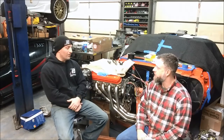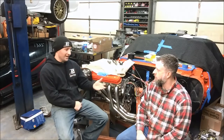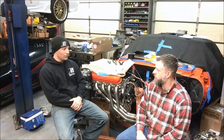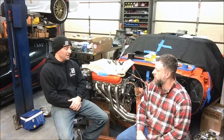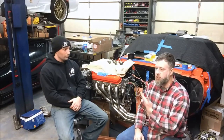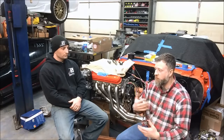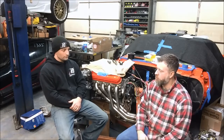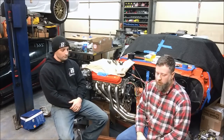On our harnesses, we offer that customization to our customers. If somebody says they're running an LS2 intake manifold with drive-by cable on a 6-liter out of a truck — an LQ4 or LQ9 — we can accommodate the different types of injectors very seamlessly for them. That passes right through to LOJ because PSI is the source for all of the harnesses sold with those swap kits. We can essentially accommodate any combination of intake manifold and engine configuration within reason. If you start crossing Gen 3 and Gen 4, it gets a little trickier — but even that can be covered, which we'll talk about more later.